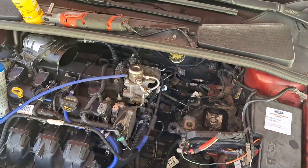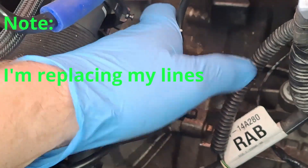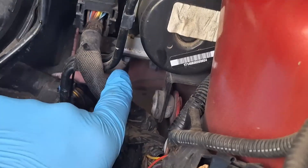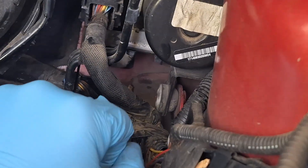Under the hood you'll have your clutch hydraulic lines. Here's the one on the transmission — this is the slave cylinder; it's got a little clip you pop out with a pick and the line comes out. Up here is where the nipples for the master cylinder stick out. There's a little clip for the hydraulic line that you pop out and the line will come out.